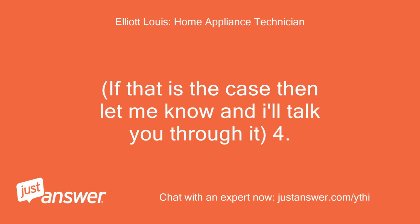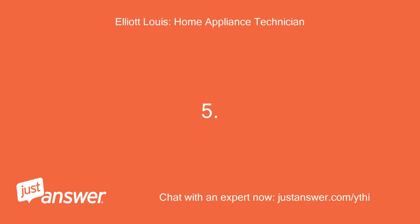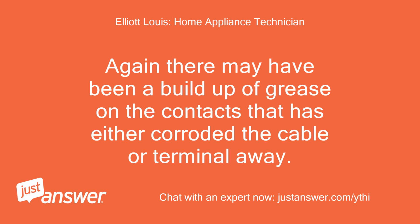4. Check the cabling going up the back of the oven for any signs of damage. 5. Inside the oven that is faulty, look for where the cables come from the back of the oven and to the fans and elements. Again, there may have been a buildup of grease on the contacts that has either corroded the cable or terminal away.